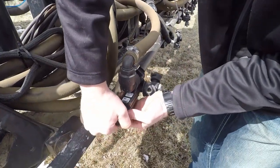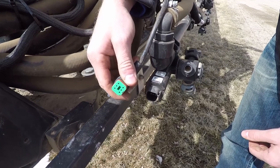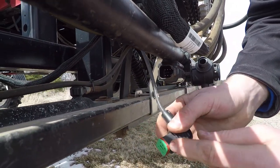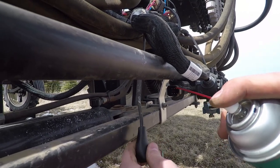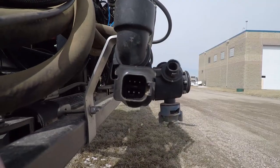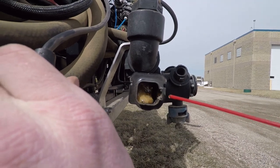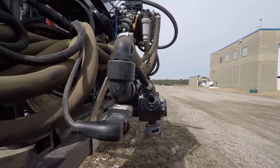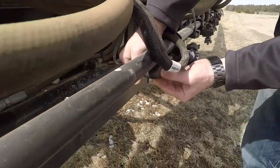Here we're taking all of the 6-pin connectors apart as well prior to the season. Same as the 19-pins - taking them apart, making sure there's no buildup of any sort in there, making sure all the pins look good and shined up, and making sure there are those orange seals around the outside to protect the system. Over time those might get lost or broken. We do the same thing here - spray in some Corrosion X HD, let it foam up really good, and plug in that connector again. You can get Corrosion X HD from any online retailer, or we offer a kit that includes additional cleaning products and brushes for dealing with existing corrosion.